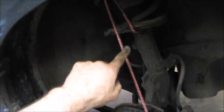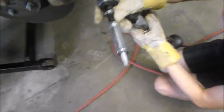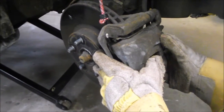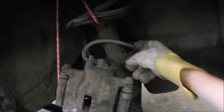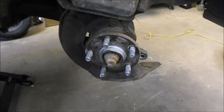Notice that we added a bungee cord so that the caliper doesn't fall off when we remove the bolts. Set your bolts aside and don't get them dirty, because if they've been assembled right before, they would have anti-seize on them. Before taking the caliper away from the disc, twist it to the side so that it compresses the piston in the bore. Now it can be removed. We take the disc off — you don't want to put any stress on the brake line, that's why we have the bungee cord. This disc came off easily because when it was previously installed we used anti-seize.